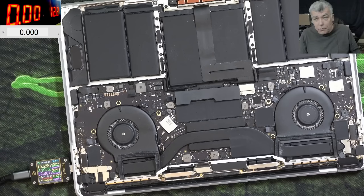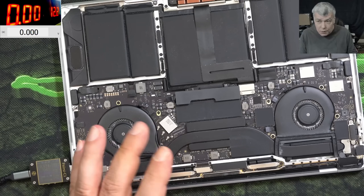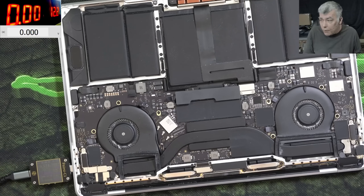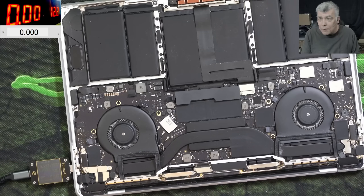I'm going to stop now. Thank you for watching — hopefully this video will be helpful. A lot of people will avoid diagnosing with the power supply just because if you don't know what's going on you can create more damage. Even I was confused at first — I wanted to set the power supply around 12 volts because that's the main power voltage, but then I thought maybe I have a shorted MOSFET and I'd be pushing 12 volts into the CPU. That's why most people avoid using the power supply, but once you figure out which is the main power rail you can push a little current and voltage and raise it gradually.